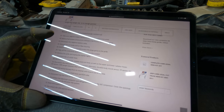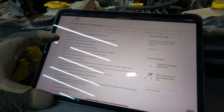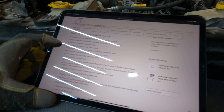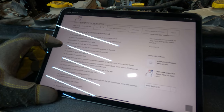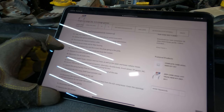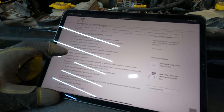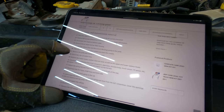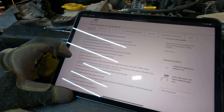We did step one: we removed the AC. Step two: we disconnected the fuel system and took the pressure away. Then we disconnected the battery — actually removed it completely. Then we removed the air intake and air filter housing — that is gone. Then we removed the battery box and disconnected the plugs going to the grill. Step six in this process: take off the underbody splash shield and drain the coolant. Step seven: remove the grill and unplug the marker lights. I pretty much already did that, except I didn't unplug the marker lights yet, so we'll get that one tackled.